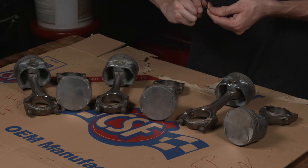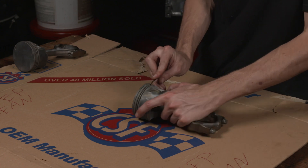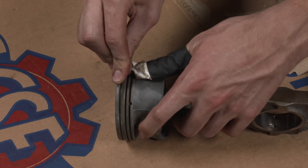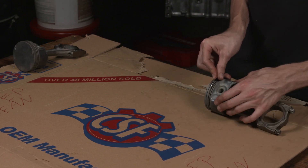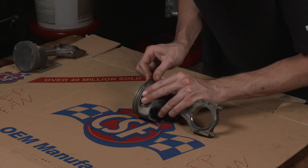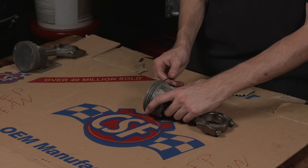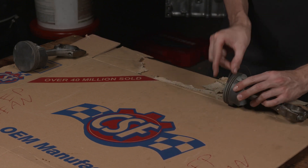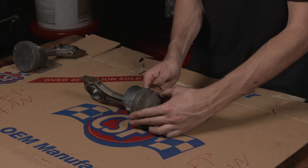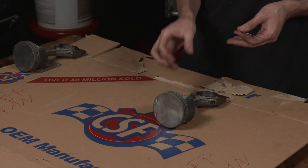It was advised by Tony from Godwin Singer, the machine shop I've been using, to break one of the old rings and go through the ring lands of each piston and scrape out whatever gunk was left over in there. This is important to make sure your rings sit well inside the ring lands. He said the water jet machine got a lot of the stuff off but isn't quite strong enough to really get all of it out. It takes some extra encouragement from a broken ring. Don't worry about particulate getting into the oil drain holes — these are also going to get a hefty dose of brake cleaner and WD-40.